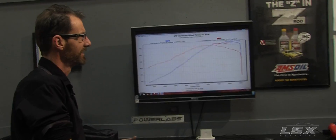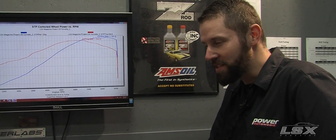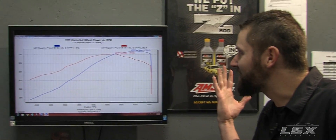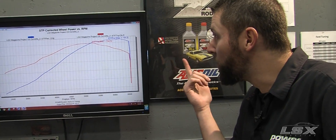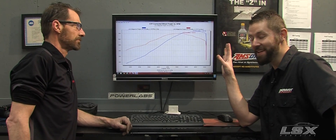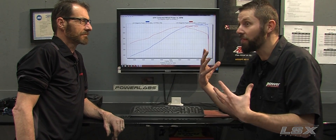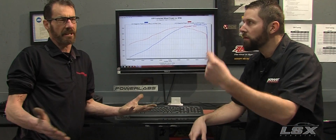735 — oh man. The numbers just speak for themselves. Still low boost, we just cleaned up the fueling, and 735 wheel horsepower and 704 torque to the wheels as well. Low boost, pump gas, 16 degrees of timing. And you can daily drive this — the car still has ice-cold air conditioning, still has power steering, still has every option including heated seats, and you can still get 25 to 28 miles per gallon on the highway. That's why I wanted to build this car.